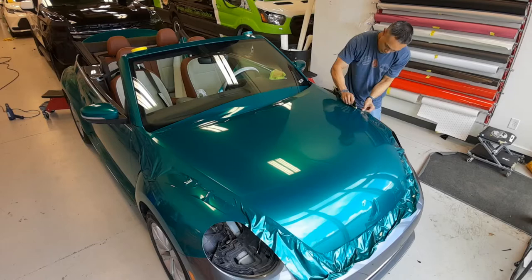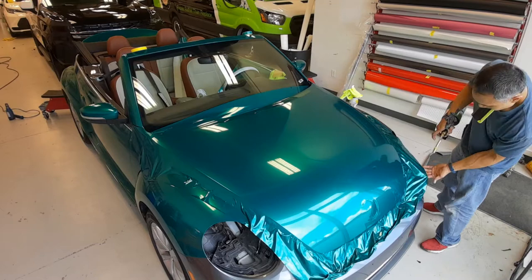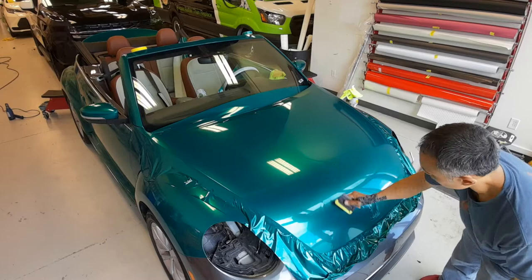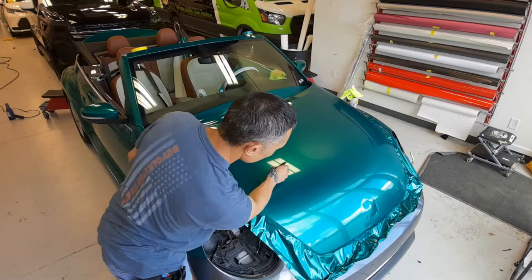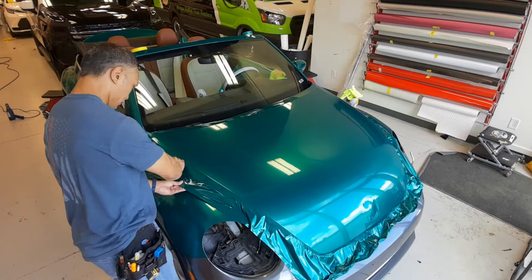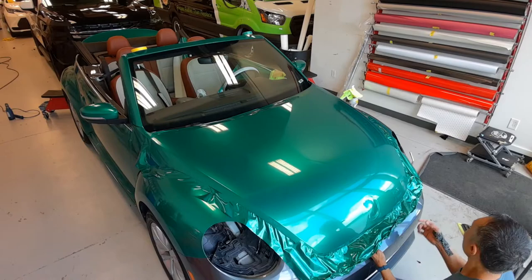As you can see I've gotten down to the edges and I'm working down to the side. I got a little bit of heat there because I had a wrinkle — I think when I peeled the paper I created one of those zippers. I'm basically working the vinyl down to the edge of the hood along the front side, then coming around to the other side, laying down using my squeegee across the top on the main surface of the hood, reaching that side edge where it drops down.